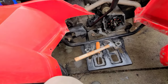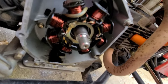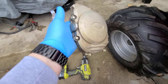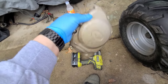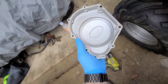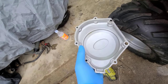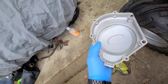So here's your flywheel. Now I'm gonna clean this oil up because we're gonna seal this up here shortly. This is held on by two eight mils right there and two eight mils on the pickup coil, so go ahead and pull those off and put the new one on. On this cover you have two different size bolts — two long ones on the front and then the rest are all short. We didn't get a gasket, and this didn't have a gasket on there — it was just sealant — so we're just gonna use sealant. We're gonna run a bead on there, let it set a little bit while we're putting this new stator and pickup coil in. I'm just gonna use Ultra Black — always a good option.